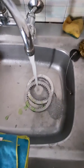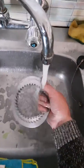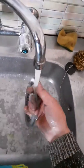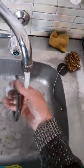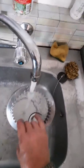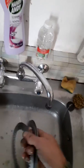You've got to make sure your hands are clean - wash off all this grit. You don't want to put this back in the engine dirty. Take some soapy water, dish washing liquid, and clean it off nicely. Then take a paintbrush or rag and wipe it with some oil. The last thing you want to do is put this stuff in dry - very important.